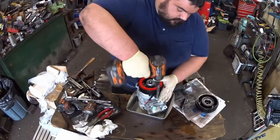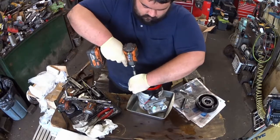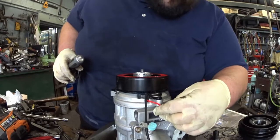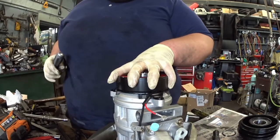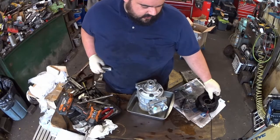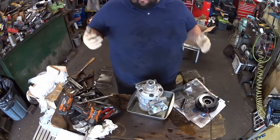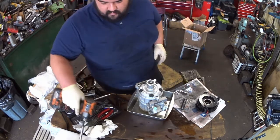We've got a field coil held on by three bolts. Some of these compressors have a ground eyelet that grounds through the compressor case. On any of these Asian compressors, note that what looks like a Phillips head screw is actually not Phillips head — Asian manufacturers use JIS, Japanese Industrial Standard, which is slightly different from Phillips. If you've ever wondered why your Phillips screwdriver is camming out on an Asian car, it's because JIS is not the same as Phillips, so make sure you have the right tools.